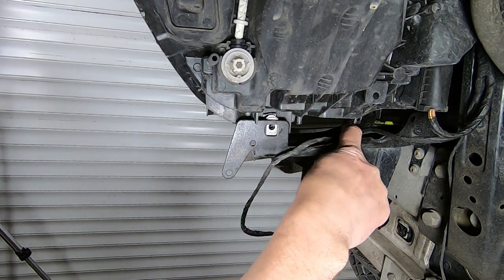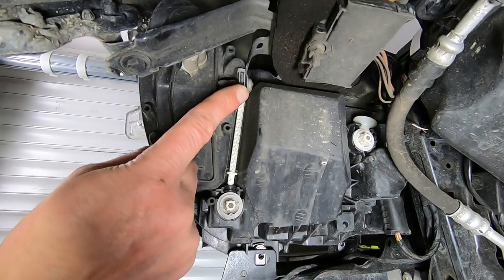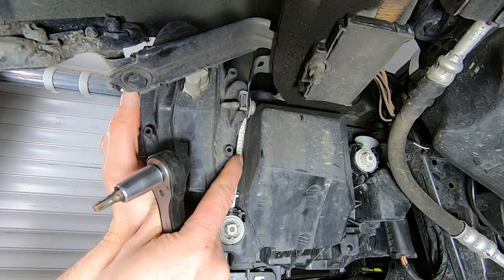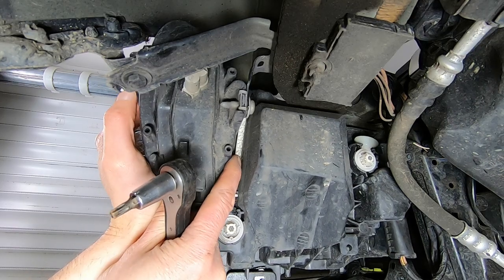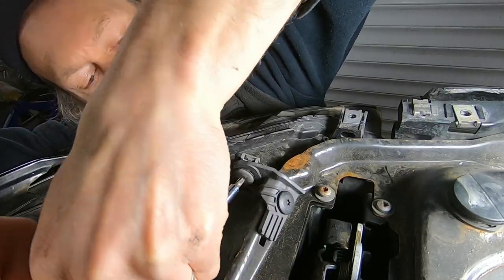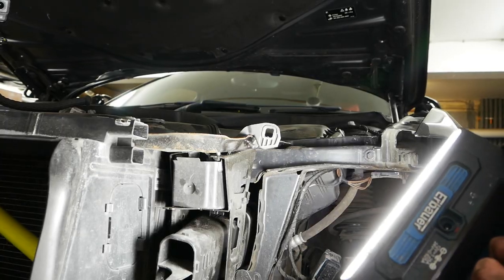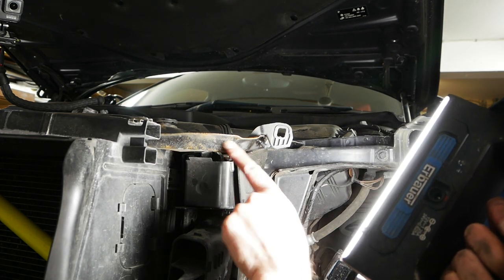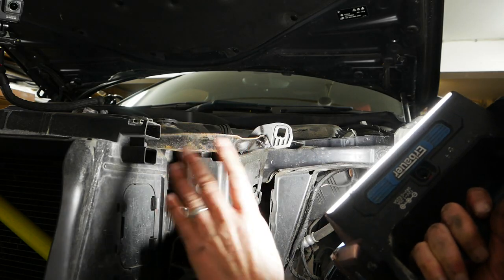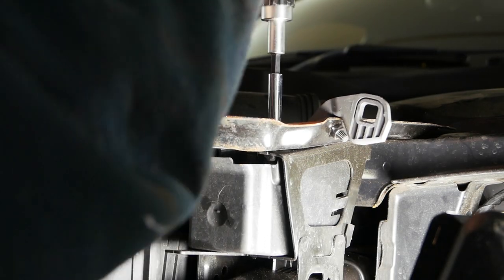Just in here there's a missing screw - I haven't removed that. There's another little screw to undo, and all of these are slotted as well, so they'll allow adjustment of the position of the headlight when we refit it - there'll be a bit of messing around to get it to fit nicely. Be careful with this - it's 500 quid secondhand. There's also a screw from the top slam panel coming down into that bracket that's clearly loose, which won't be helping the alignment of the slam panel and the bonnet latch, so I might as well get that tightened off while I'm here.